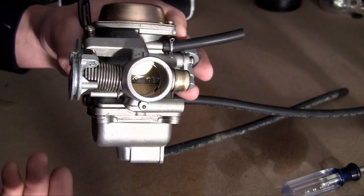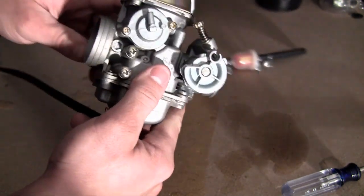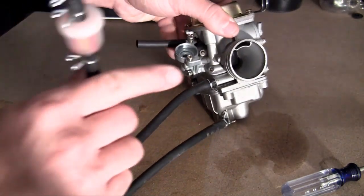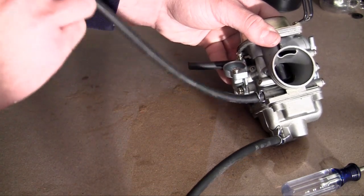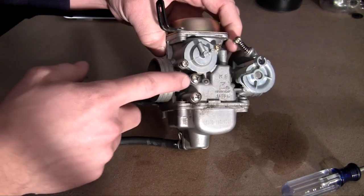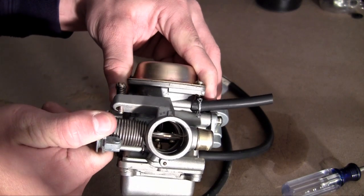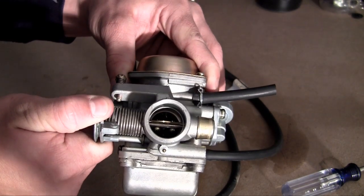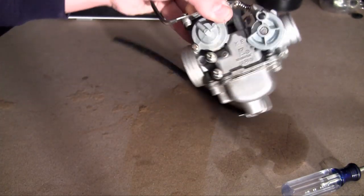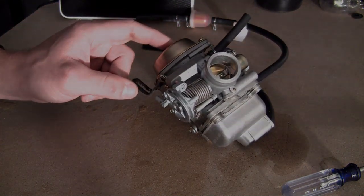Of course, the more fuel going into your engine, the faster your go-kart is going to go. So just to recap: the air comes in through here on the air intake, the fuel from the gas tank comes in right here, inside it controls and makes the perfect ratio, and depending on how hard you're pressing the gas pedal, the wider this door is going to open and the more gasoline gets into your engine. Now that we understand what the carburetor is and a basic overview of how it works, in the next video I'm going to show you guys how to install this on your go-kart.